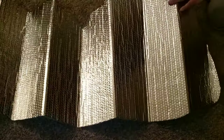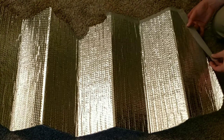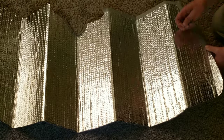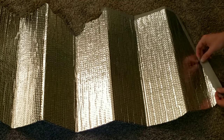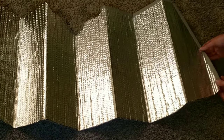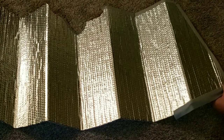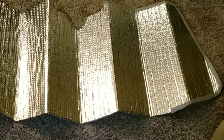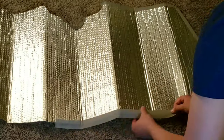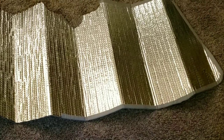You will simply outline the outside of the sunshade with cloth tape. While the cloth tape is not as thick as the original binding material, it is pretty close. The goal of the tape, like the binding material, is to hold the thin plastic foil against the bubble insulation inside the shade. To do this, fold the tape over the edge of the shade with 50% on one side and 50% on the other. Do your best to keep the overlap equidistant to make a nice finished edge.